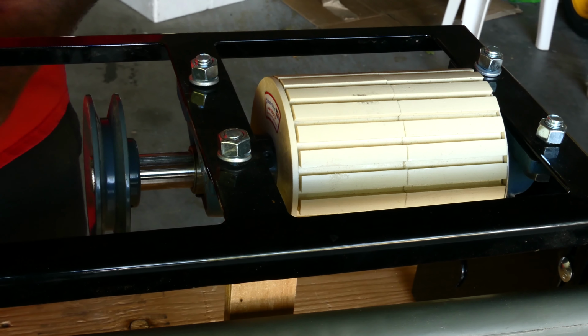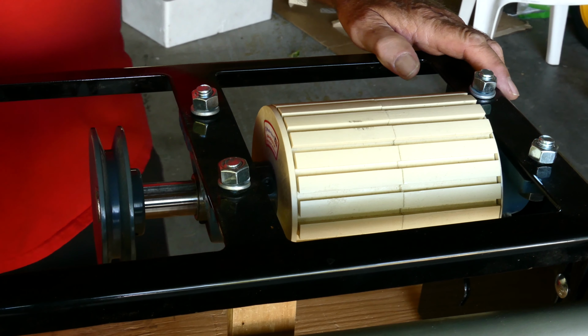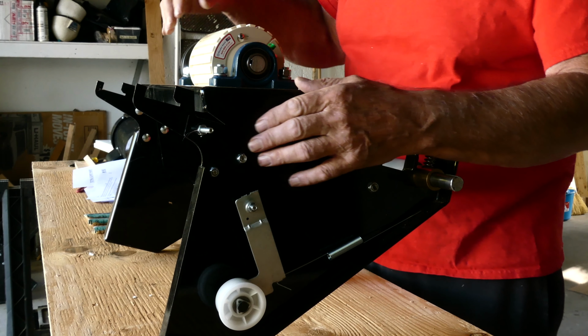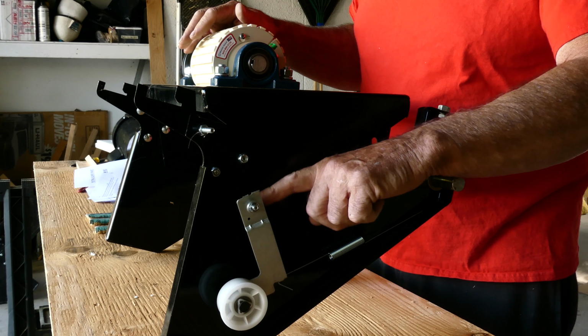Also your top mounts here are just bolted in. Just loosen the bolt, pull the other one out. These will pull up, and I'll show you on figure 2 here what it will look like. This is all put together. You can see that the mount hinges here were brought up, and you can see that there's a 2-inch screw here, or bolt, and a 2-inch bolt here.